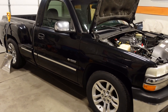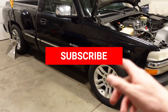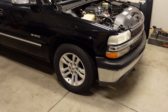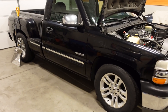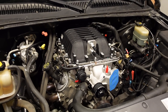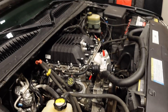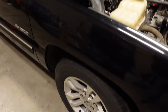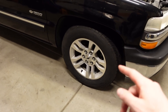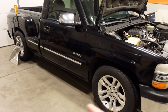That started with the powertrain. We have the all-wheel drive system from a Silverado SS or a Yukon Denali — the NV149 transfer case and the 8-and-a-quarter IFS with the one-piece passenger side axle shaft. We're going to have a 4L80 transmission from a heavier-duty truck like a 2500 HD. Of course, we have the power adder: an LSA supercharger, which would have come on a CTS-V or a ZL1 Camaro. And then some little stuff like dual electric fans, hydro boost brakes, and even bigger brake upgrades from 2005 and later or even 2019 Silverado hardware.